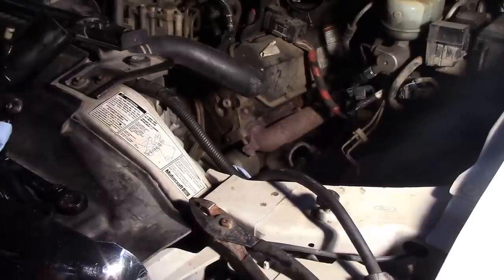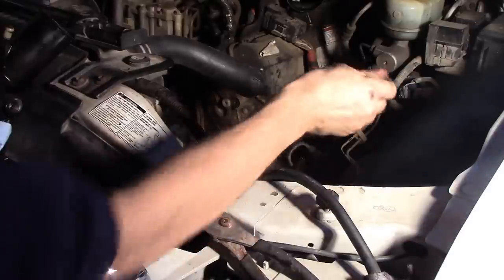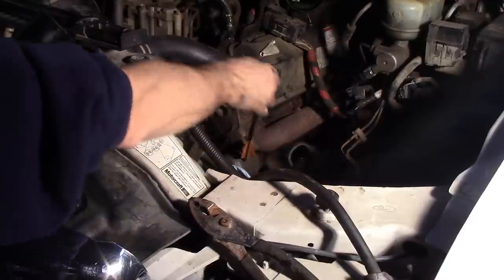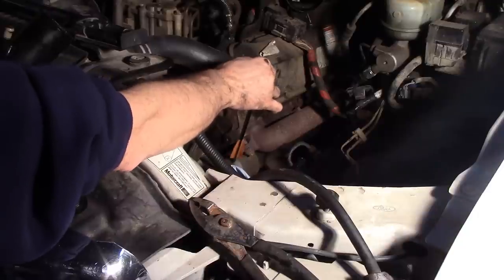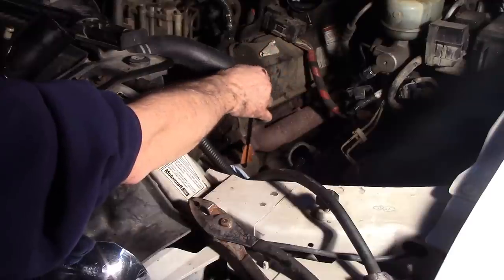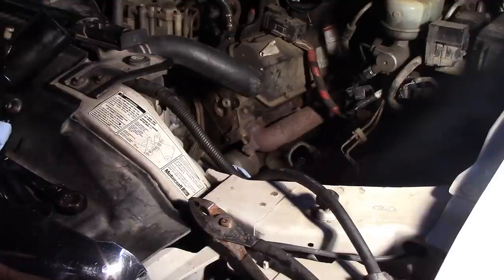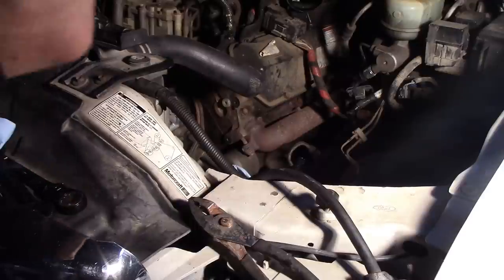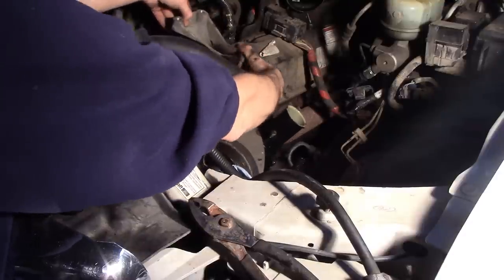One other thing to mention: if you happen to have a problem with your oil cooler leaking, now would be the time to do something about it — right there is your oil cooler underneath your exhaust manifold, nice and wide open to get to. If it's leaking at all, now is the time to tear it out and reseal it, because otherwise you have to do all this work anyway to access it. So try to do as many things as you can while you're in there. Take the pump and bracket, stick it back in position, and put the four bolts back in.